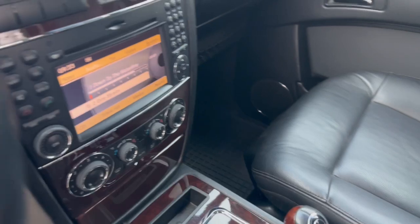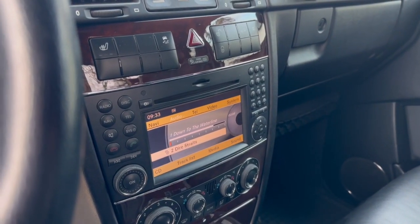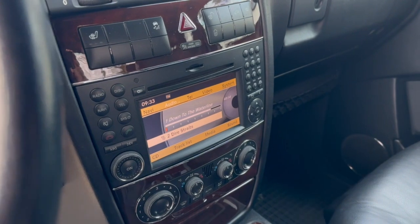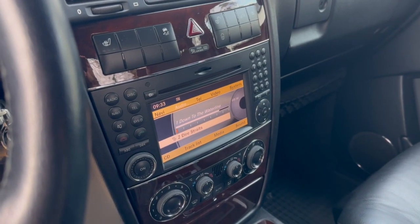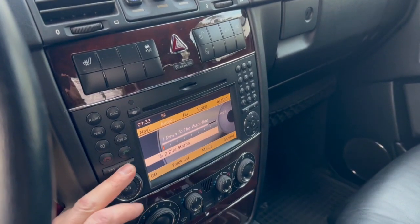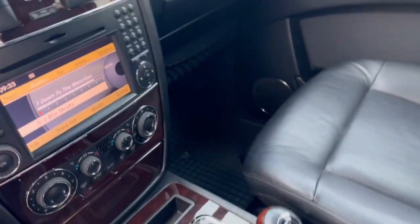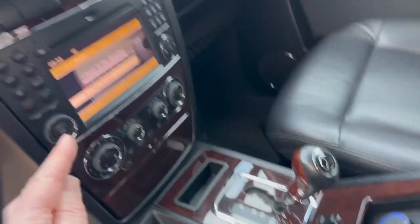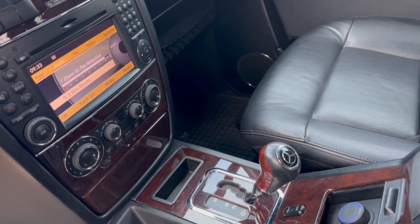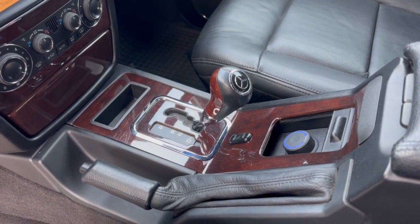As well as integrating to the Command unit, we've added something called an Audison B-Com, which is a high-resolution Bluetooth streamer. That way we could keep the original source in place - the customer can still play CDs, which as you can hear we're playing at the moment. But we've also got a high-res input which is controlled from here. A couple of taps of this button and we switch away from the Command unit and over to the high-res streamer. Then we can play things like Tidal, Spotify, whatever we want from our mobile phones at good resolution - exactly what you'd want for a hi-fi.